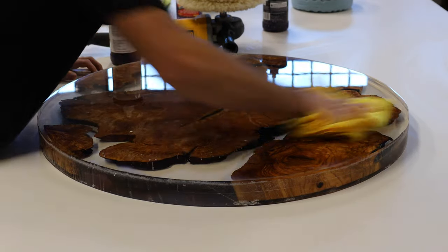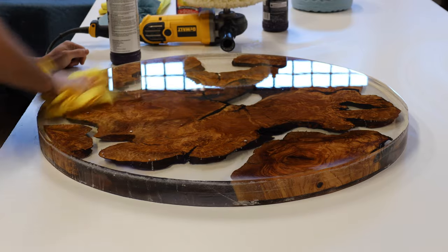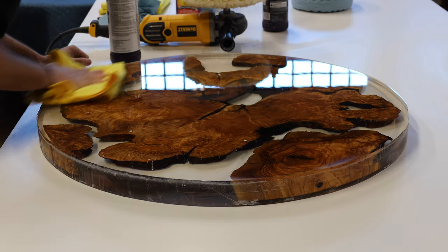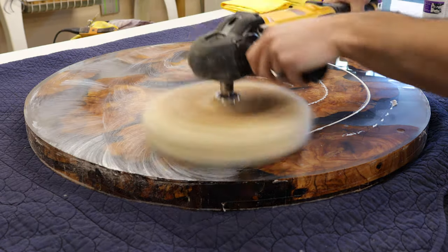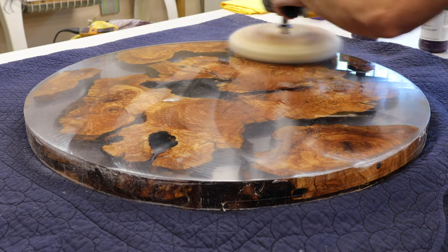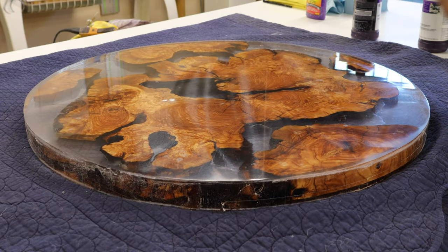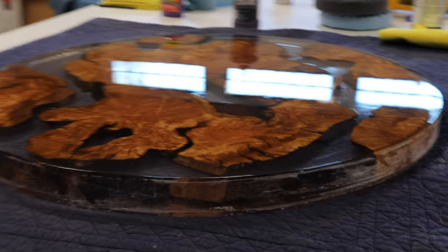Make sure you're doing the same crosshatch motion. I just finished up with the second pass on step one, running about 2,200 RPMs. They recommend up to about 2,000 but I find that to get all the pigtails and swirl marks out a little bit faster it helps — you just have to make sure you move it around quite a bit. Step one is complete with the wool pad.